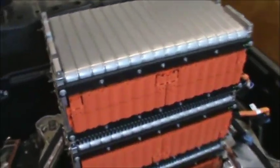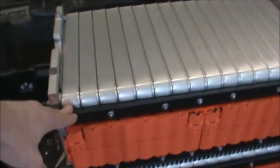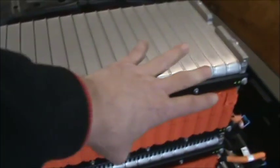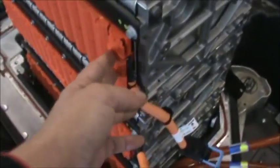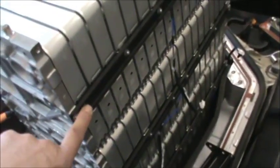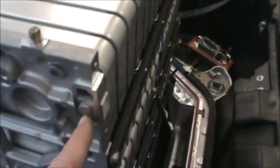They're just sitting in the bottom of the base here. Over here we have these metal straps that go down the whole way for reinforcement, keeping the whole thing together. We have all our strapping and BMS wiring underneath, and this is the BMS pigtail so it'll come off with the cells. On the back side there's a single strap in the middle as reinforcement, and then we have our through pins — it's just sitting in there.